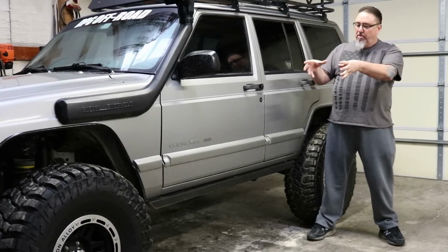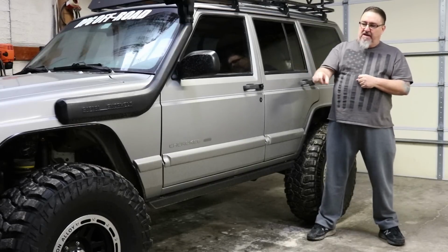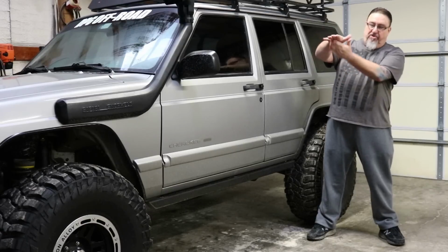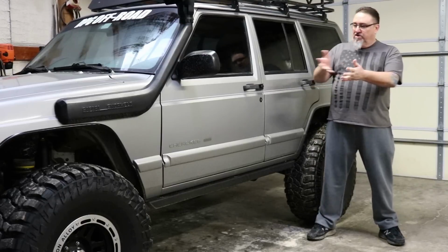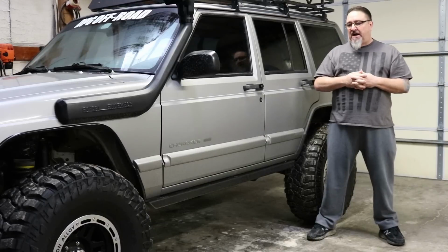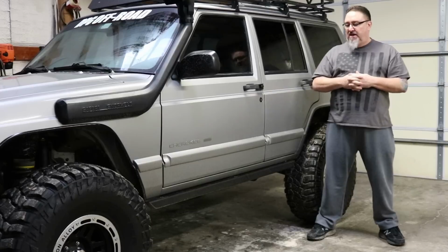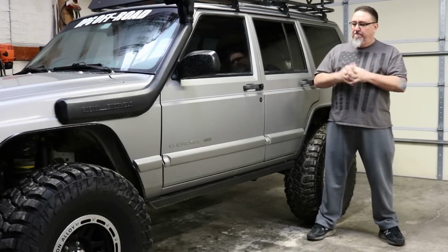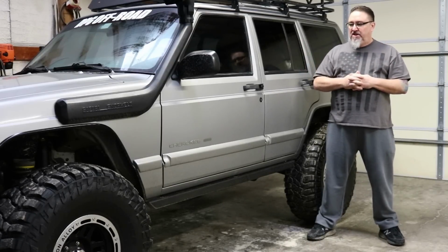And then of course, once your parameters are set, the bigger the tire, hopefully the bigger the trimming. Of course, you have to have a certain amount of lift to support a certain tire size and still have some up travel to work with. There's got to be a balance there. On our 2000, this is one of my personal rigs, there's 35-inch tires, and this is our 3.5-inch Super Ultimate Hybrid Kit. It's an Old Man Emu JKS DPG Hybrid package, very popular. But we get full suspension use and flex out of that Jeep.